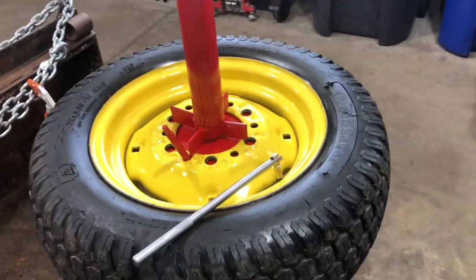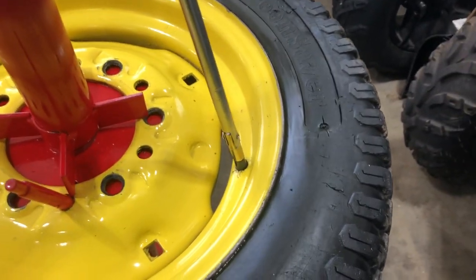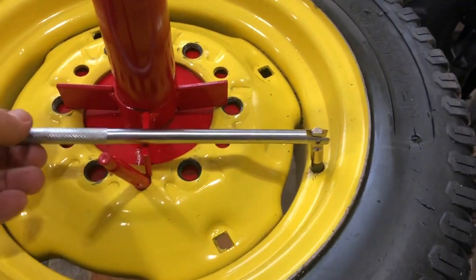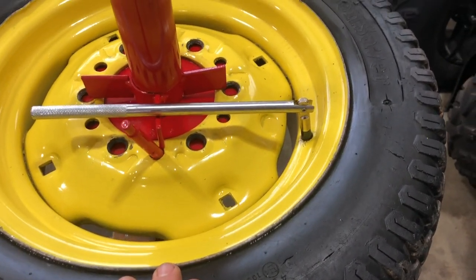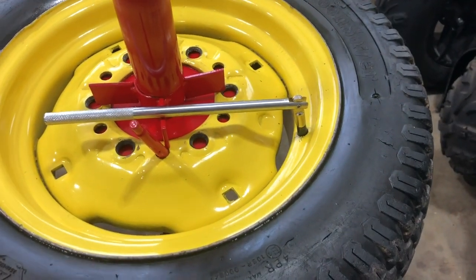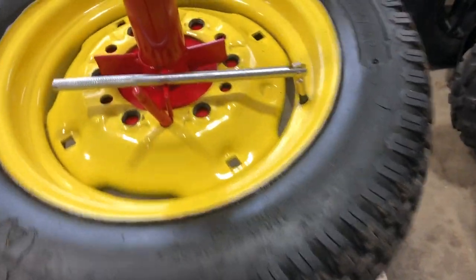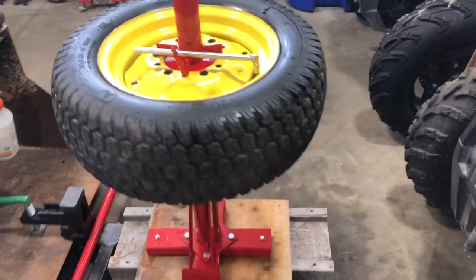The tube is in the tire, and one tip I can offer: this is a tire fill tube wrench — it spins onto the end of the fill tube. The reason you want to put this on is because when you put the deflated tube inside the tire and you're trying to put the top part of the tire back on the rim, the fill tube will want to drop inside the rim and you won't be able to get to it. If you put this wrench on the end, it lets you work the tire without having to worry about grabbing the fill valve afterwards. That's a big tip and a big time saver, because otherwise you'd have to pull the tire off again just to get to the fill valve and push it through the hole in the rim.